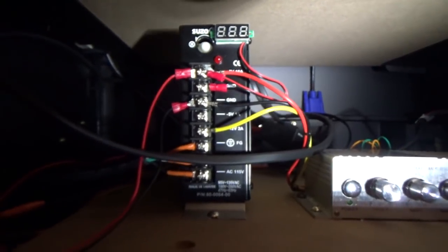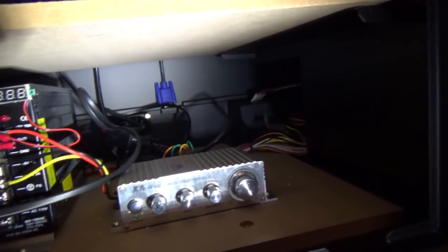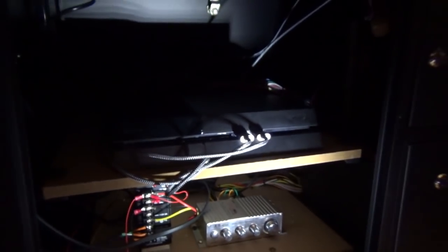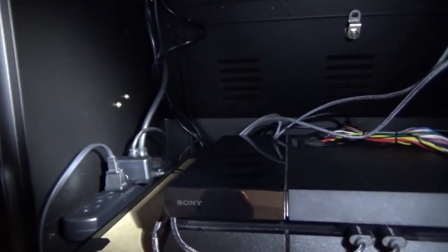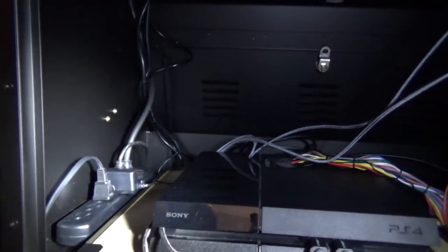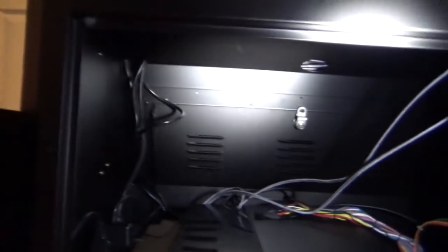Here is the inside of what the fake ViewLix looks like. Stock it came with a really bad bootleg arcade power supply, so I threw in a HAT Power Pro because I trust those more. It does come stock with a Lepai or similar little plug-in amp which is nice because it takes RCA inputs. Originally it came with a Chinese power cord so I put in a power strip on the side with five power plugs - the original Chinese two-plug setup used weird three-prong plugs like miniature dryer plugs. I cut all that out, put in a better power supply, and ran a normal American plug for the monitor which feeds up to the back of the monitor.